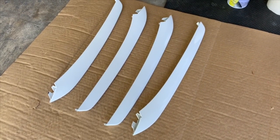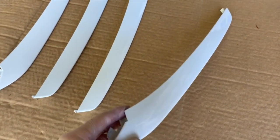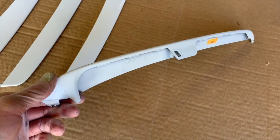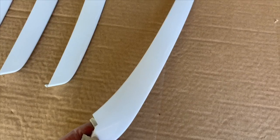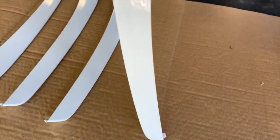The next interesting thing you need to figure out is how you're going to get full coverage of the piece, which is kind of an awkward shape. You could hold it, but that probably really wouldn't work. You could set it flat, but then you'd have to either wait for it to completely dry and turn it over, or you're going to end up potentially getting some blemishes. Or you could turn it on its end or hang it, but then you get the lovely dripping potential.